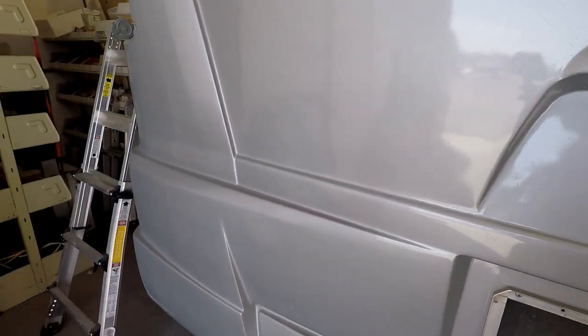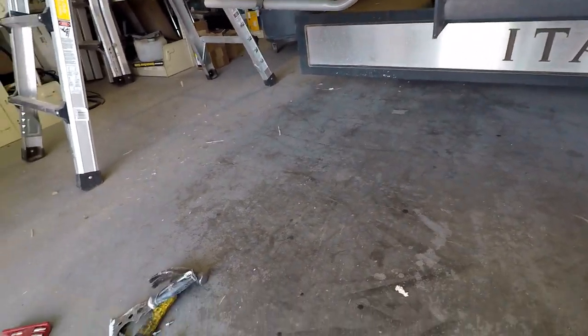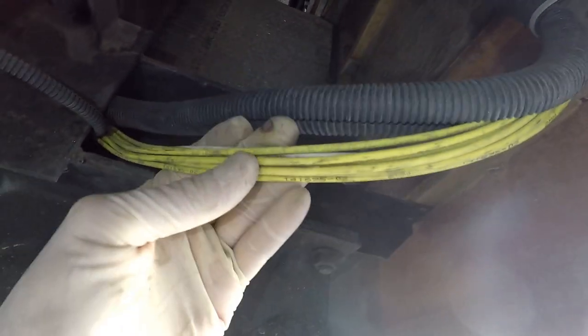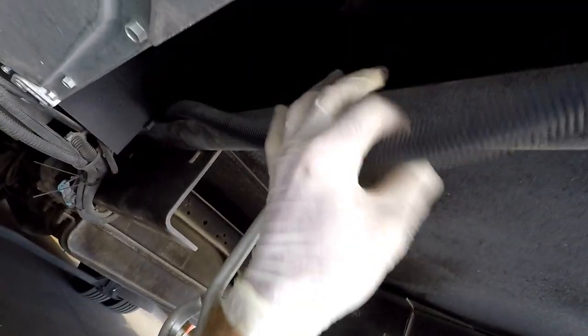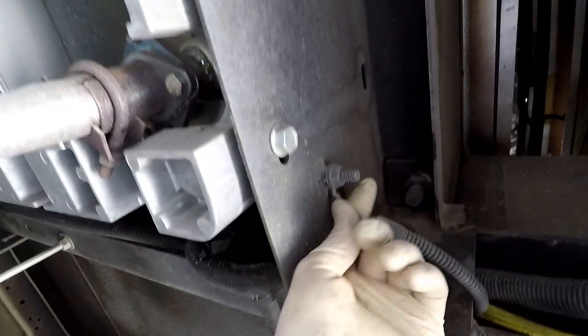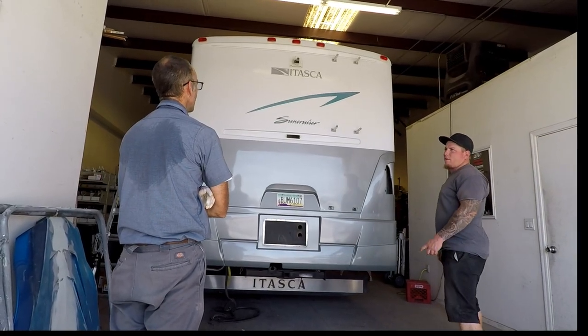Okay, this is actually pretty loose now. Before I go much further, there's something else to do real fast. This wire harness right here runs to the back lights on top. I was about to cut this free because I just could not see where Winnebago — or rather the chassis manufacturer — puts a quick connect plug where it goes to the bodybuilder coach harness. This is a Workhorse chassis, so the connection is way back there. I just have to cut those zip ties loose, fish this forward off the frame, there's a main ground I've got to take off, and then disconnect the power out of the tow plug, and then we'll be ready to go.